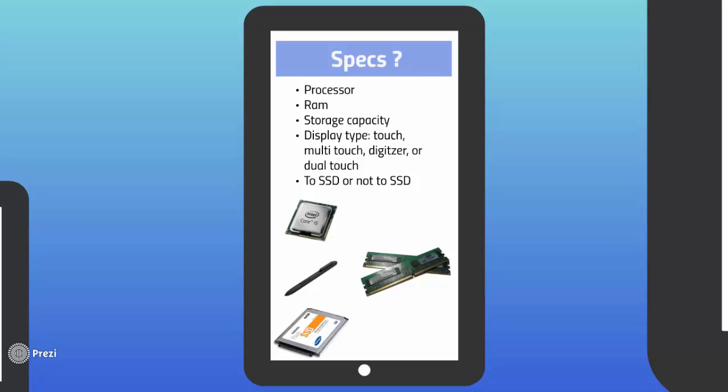Next, you have the digitizer — a great option that uses a magnetic stylus for input. Fingertip touch will not be recognized. It's preferred over standard touchscreens, as digitizers are more precise and are the best at capturing natural handwriting. This is great if your EPCR supports digital custom documents. Next up, multi-touch — the most modern technology, supporting multiple points of touch up to ten for your ten fingers. These screens are more precise and provide a better response, but still suffer from the signature problem. Finally, we have dual-touch: the best of both worlds — the precision of the digitizer with the flexibility of the touchscreen. These screens do not have the signature problem because when you lay your hand on the screen while holding the pen, it recognizes the pen as the point of input.